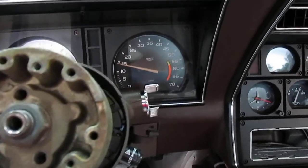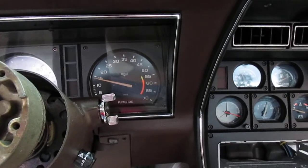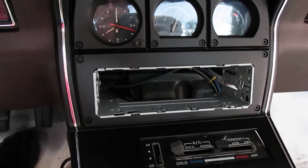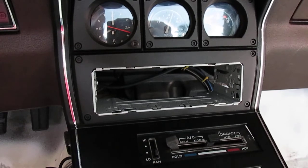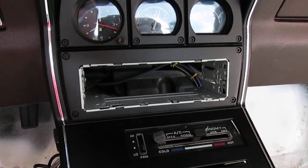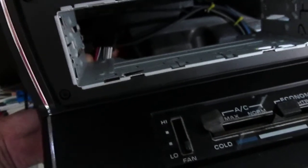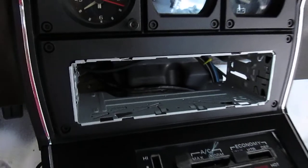It's got a couple screws that hold it in there and it's got some tines that make connection back in there. I'm going to pull it back out and see if I can figure out what's going on with it. There's my center console with the new DIN style stereo adapter, the sleeve that slides in — that worked out really nice. I've actually slipped the stereo in there and it clears everything, not hitting anything. And there's still plenty of room underneath there to run my wires. I'll be able to go through the hole with them and connect them up, then just slide the stereo in there. Turned out pretty nice.